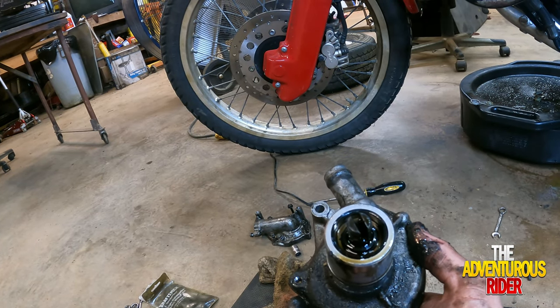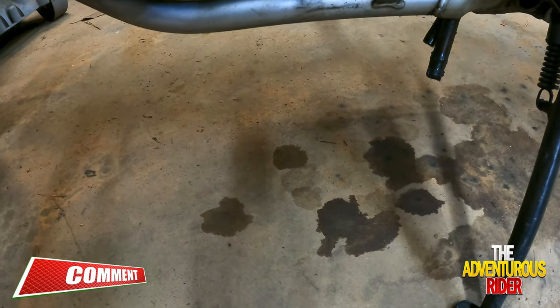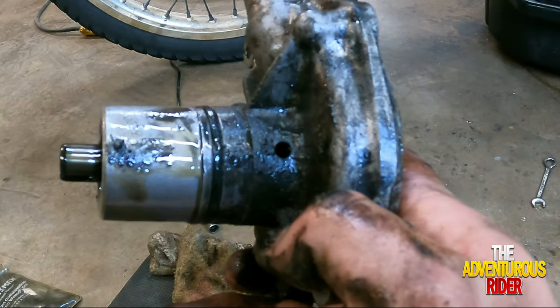The oil seal that needed replacing is the one you can see right there in the groove. What's going on YouTube — welcome back to the channel. In today's video we're working on a little oil leak I've developed on the Africa Twin. I noticed after going on some rides that after it had been sitting for a bit I had a little puddle of oil right underneath the motorcycle. When I went to take the skid plate off I noticed it was coming out of the little weep hole right here, which is actually between the oil pump and water pump. The way it works is your oil pump has a little drive coming off of it to turn your water pump, and there's a little oil seal between those two to keep oil from leaking into your water pump or out of the weep hole.